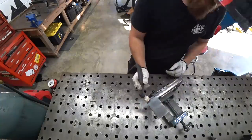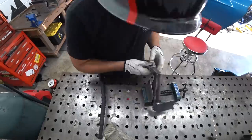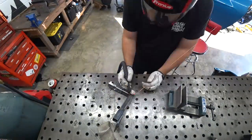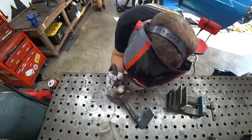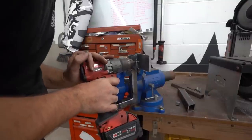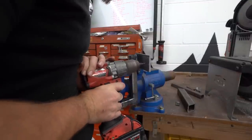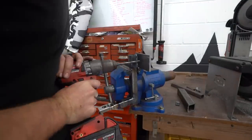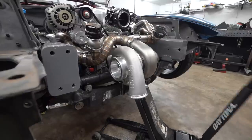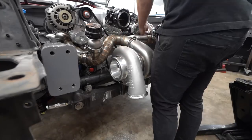I was very cautious welding this out — it's a precise fit because the turbo is already positioned by the exhaust. If anything moves, tightening it down will tension the turbo against the exhaust, which defeats the purpose of the mount. We drilled holes, centering them in the plate to have plenty of meat, starting with small holes to transfer positions to the subframe before drilling to final size. We got it all bolted in for the moment of truth.